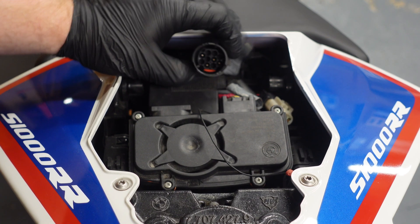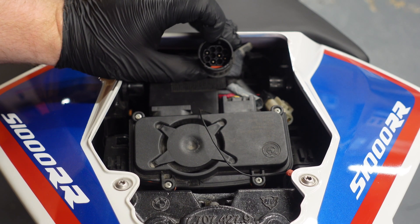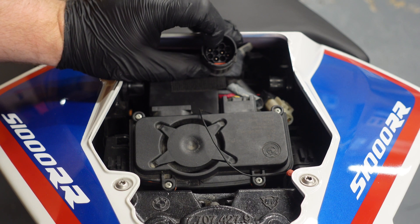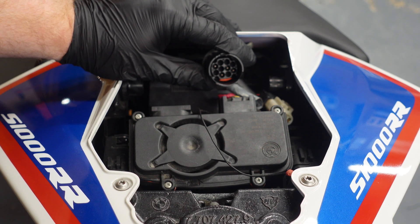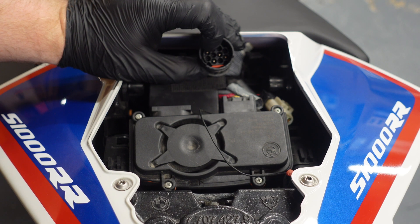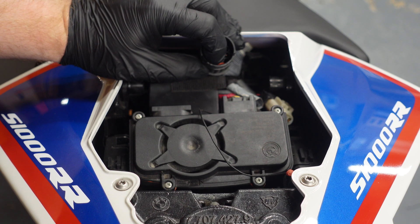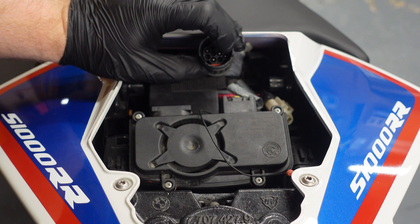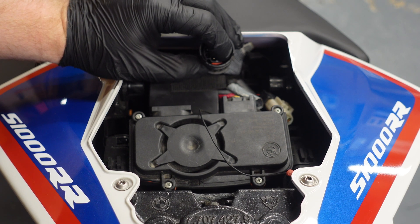If you're looking at this OBD plug with the orange connector facing down, the first pin up here is gonna be your ignition. You can get cable with just pin adapters on them, or any kind of spade terminals, and push them onto these pins. The one down here is gonna be your 12 volt — that's the 12 volt to read when the ignition's on. The one up here is going to be your ground. And then this one over here is gonna be the K-line, to be able to pick up all the communications between all the modules. You're gonna need to have the K-line properly connected.